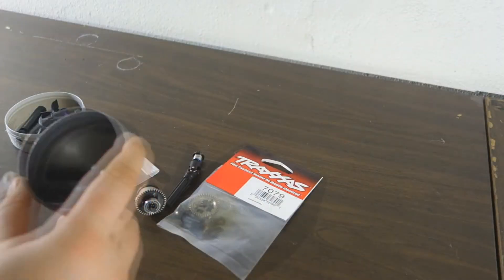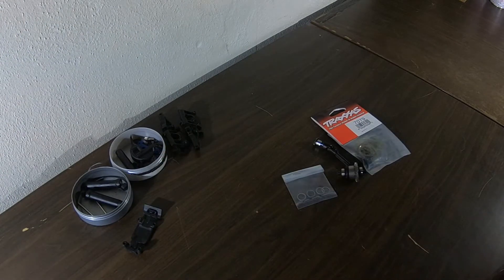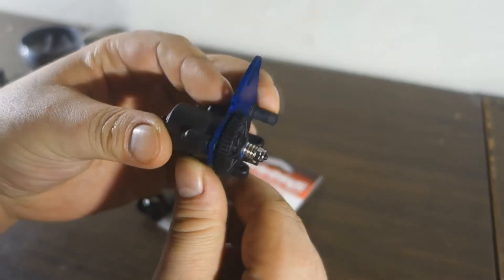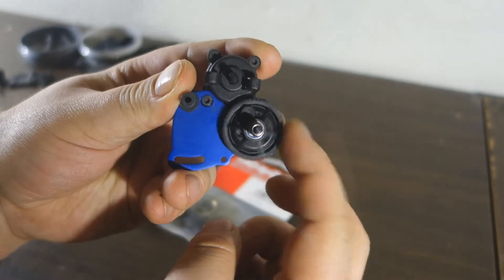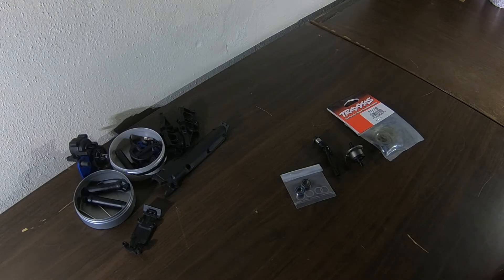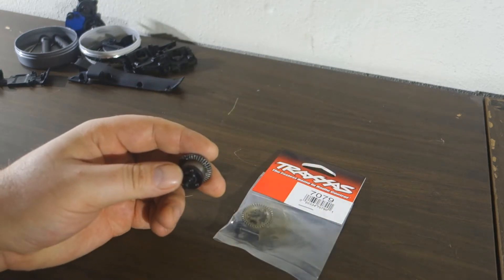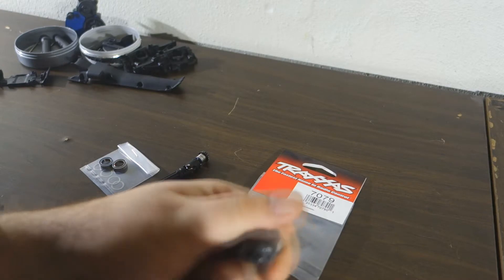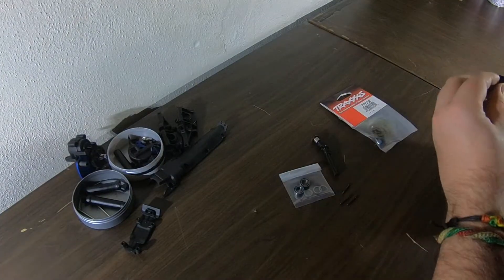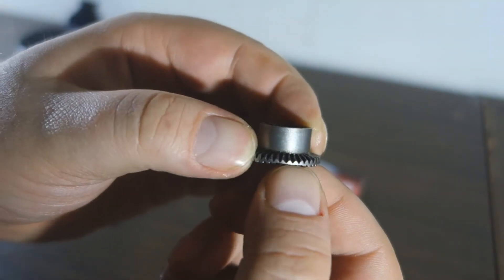Let's build the back differential. There was nothing wrong with the gearbox — I'm so happy about that, it's still intact. Some of my hex screws are really bad so I have to go for the manual ones. Let's try and see if this goes any better. Everything looks good inside. This is the broken one and it's really torn down — like three or four hairs of wear. That's what happens with the first run on 3S on the Summit.